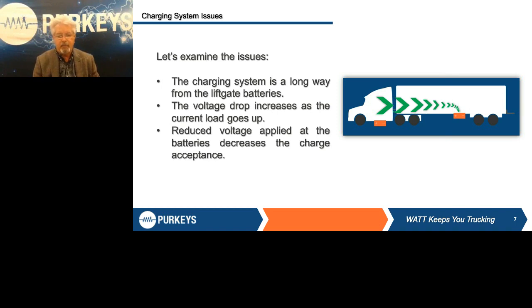So how do we test the batteries? The first thing you want to do is put a voltmeter across your batteries — they must be 12.4 volts or higher, or you don't have enough charge in those batteries to properly test them. Don't ever make a test with discharged batteries, because those batteries could show up being bad when they simply don't have enough charge in them to properly test.